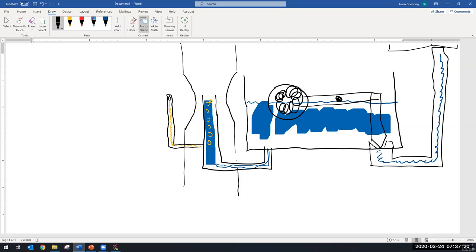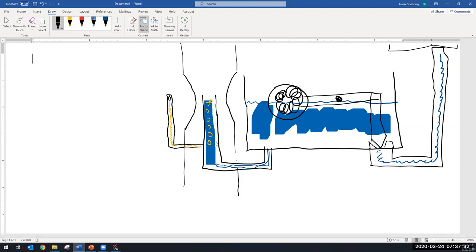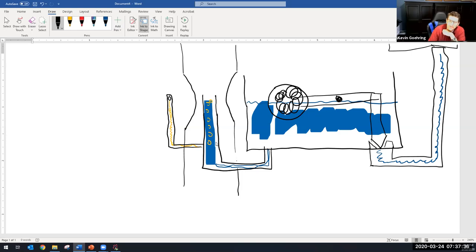So I can see that the holes are in the main discharge nozzle area? Well, those are bubbles — the yellow things represent bubbles. Oh okay, so it literally just sucks the air with the fuel. Yes. So this right here is bubbles and fuel mixed together.